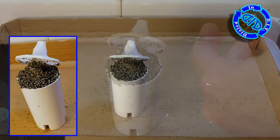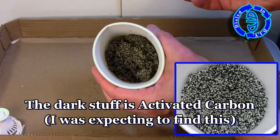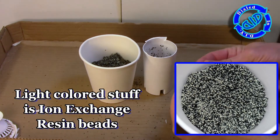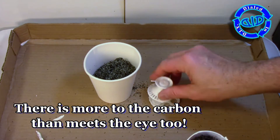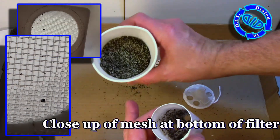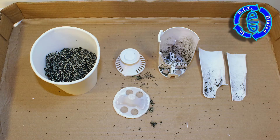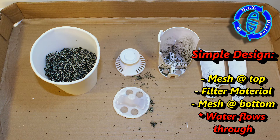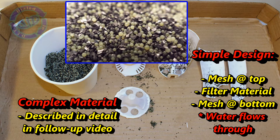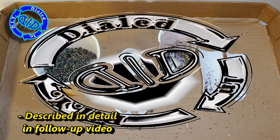What you're going to find inside looks like it was scooped right off of a black sand beach somewhere. The black stuff in here is activated carbon, which I was expecting to find once I got inside of this. However, the light colored stuff I wasn't quite expecting — that is actually an ion exchange resin bead that is utilized for another purpose that we're going to get into much further in the next video. You'll see at the bottom there's also additional mesh material, but this one has a tighter weave, which allows for better water control flowing out and better contact time between the water and the filtration material. The design itself is quite simple, but the material inside is a bit more complex. In fact, there's even more to that carbon material than meets the eye, and we'll talk a lot about that in the next video.